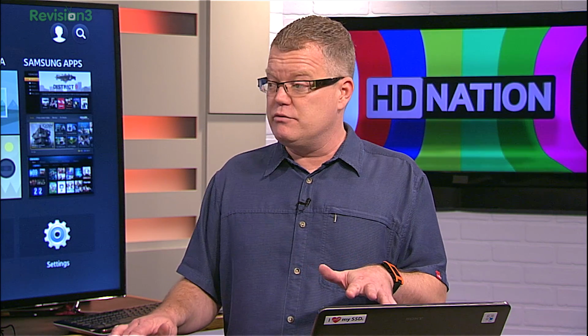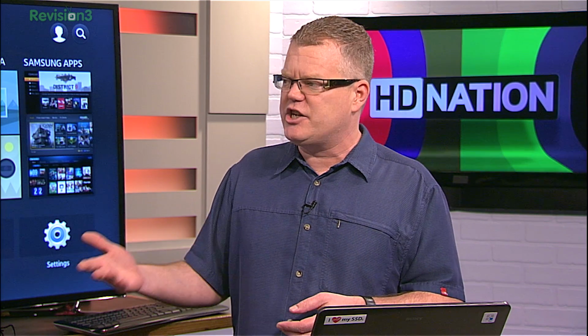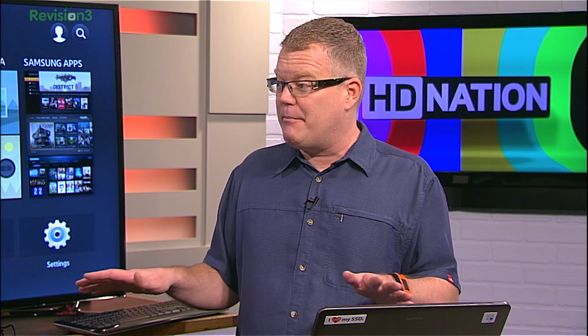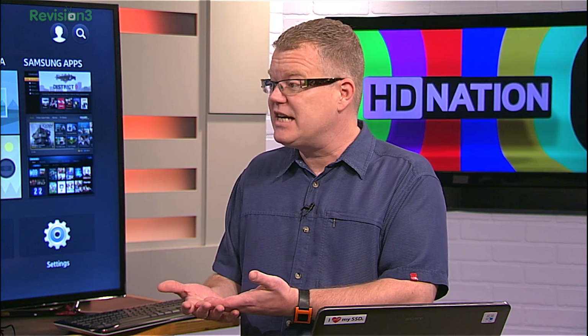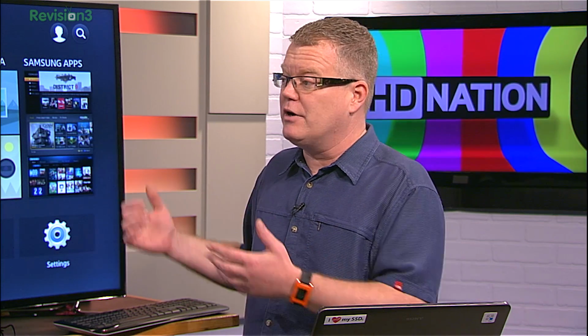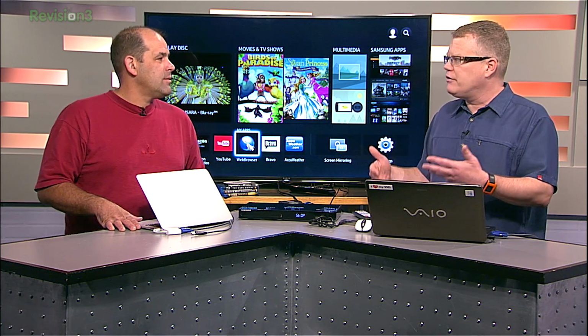Panasonic was the first to really do this in any consistency, but they always made it an optional feature that never stuck. You had to enable it every time. This has an auto setting where you set it once, forget about it, and then every DVD you ever put in, if it has that original film-based signaling on it, it will convert that back to 24p and spit it out at whatever upscaled resolution you want. That was really convenient, and that's something that I begged Panasonic to do forever, and I don't believe they still have, but this is doing it, and it did it well, and it worked with every disc I have, and I didn't have to enable it every time.